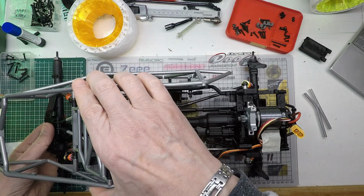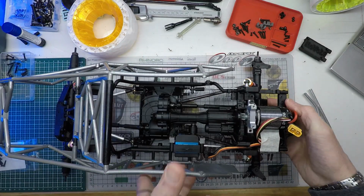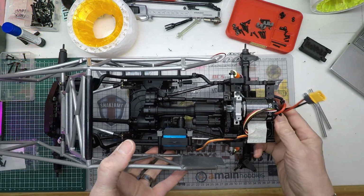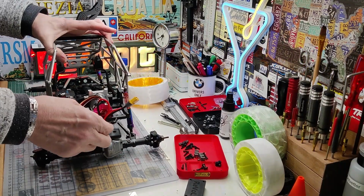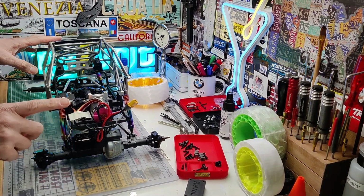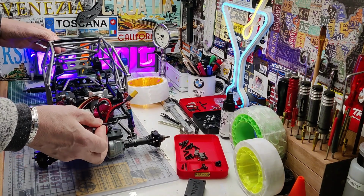The rear feels actually good without oil, so no damping. These springs feel actually good, but there's a lot of weight up front in this vehicle, so it feels okay, but when I use the car and its weight, I think no, that's undersprung anyway. Might help setting them up. The damping will also change that feeling a little bit.